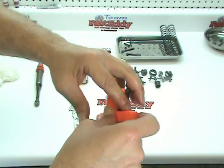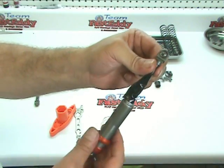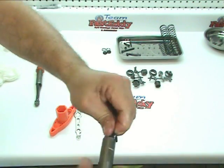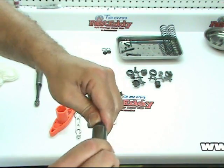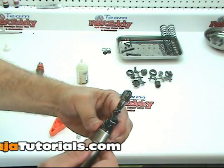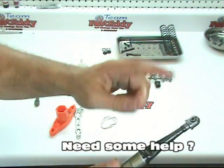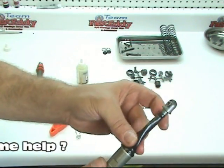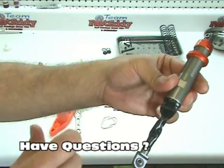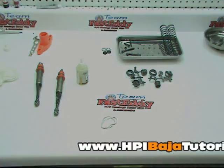These boots are a pain, but you have to put them on before you build the shocks — otherwise there's no other way to get them on. We're still attached on the bottom; I'm going to go ahead and reattach this on the top, then we're going to shut the camera off. We're just going to clean up all of our shock fluid mess here so it doesn't get all over everything during the rest of our build. I do suggest that you wipe this stuff down — you can use a little bit of denatured alcohol or whatever — and try to get as much of the shock oil off of the outside as possible. As you're running, it likes to collect dust. We'll be right back and we're going to finish up the build on the shocks.